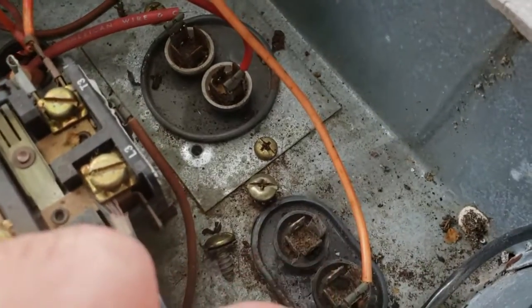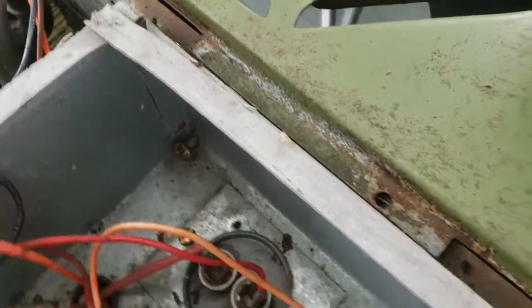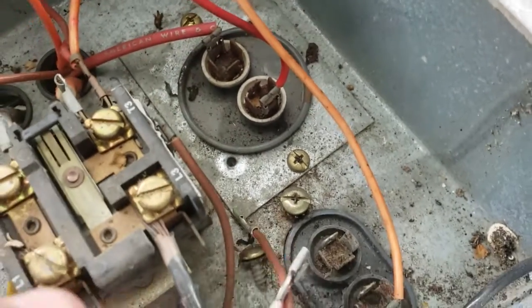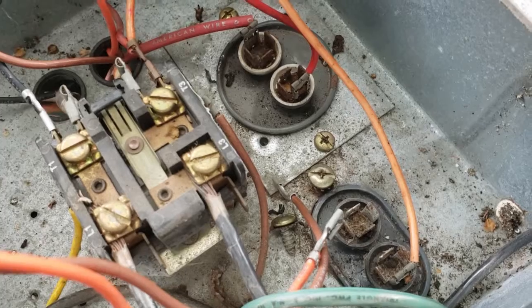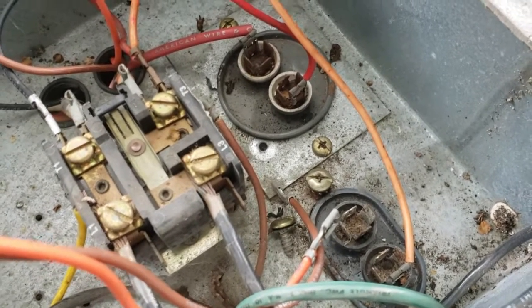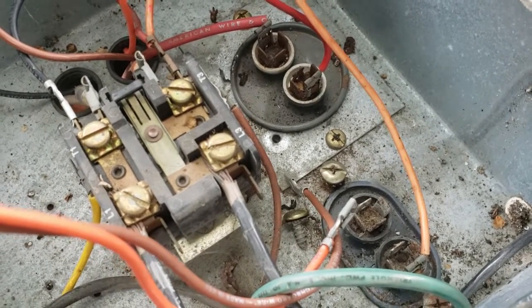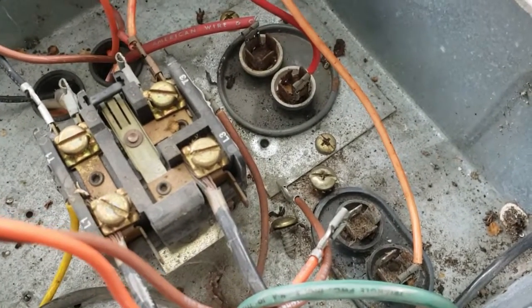The wiring obviously is you have the orange and the brown coming over here that will attach to this one, and then the 2 reds on this one. It doesn't make any difference which way they go because these are non-polarized. Remember, this is AC, not DC, so they are non-polarized capacitors, and they are run capacitors, not start capacitors. The start capacitors are much higher, 200 to 300 microfarads, so they'd have to have a big boost, whereas these are just run capacitors, which don't have quite that much.